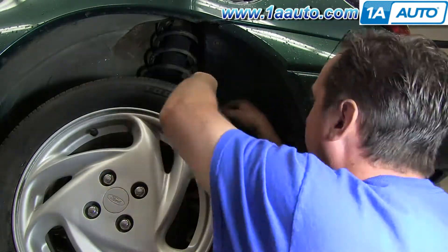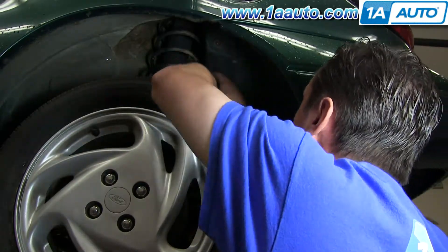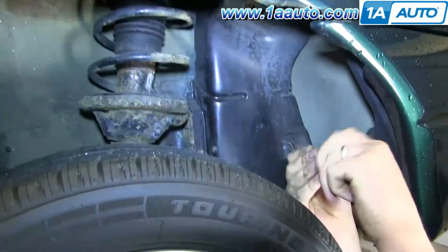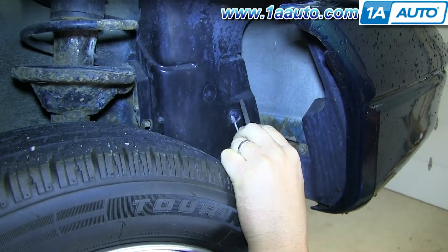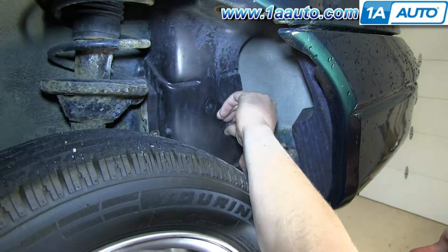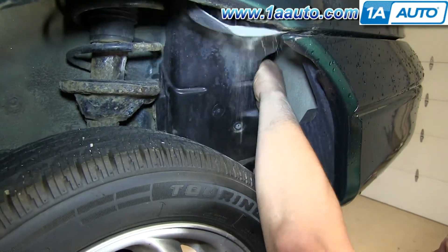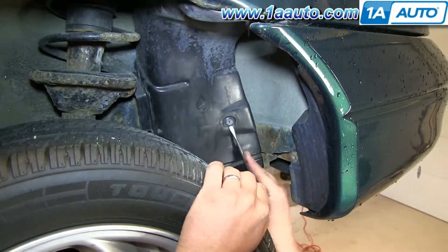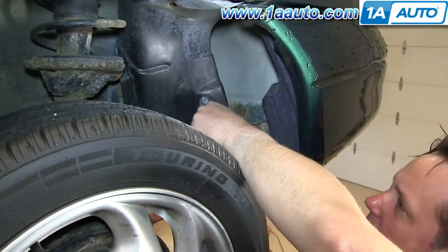The two 8 millimeter bolts come out pretty easily. On the plastic rivet, it's basically a little clip with a Phillips head in the middle. You should be able to twist the Phillips head out counterclockwise, but what always happens is sand gets stuck in them and they don't come out well. We ended up breaking the screw head off and then just pushing the clip through and pulling the whole assembly out.